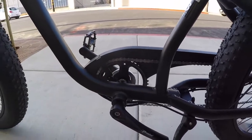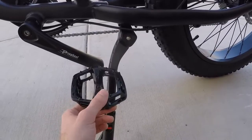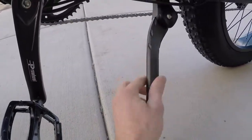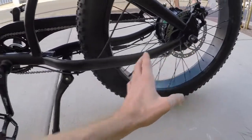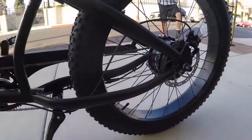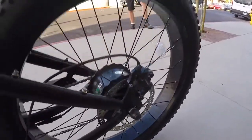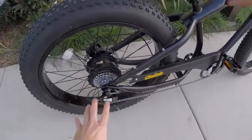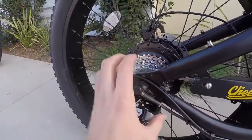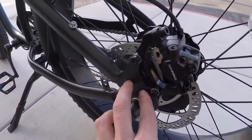I like where they've positioned the kickstand, though there's a little potential pedal lock — as long as you tip the pedal it doesn't hit. There was a little damage on another kickstand unit, but if you put it too far back the front wheel can flop around on a heavy bike. We've got nice big dropouts back here, a 12mm axle, and the power cable coming out the side. There is space for a derailleur guard or rack support — two threaded eyelets on each side.